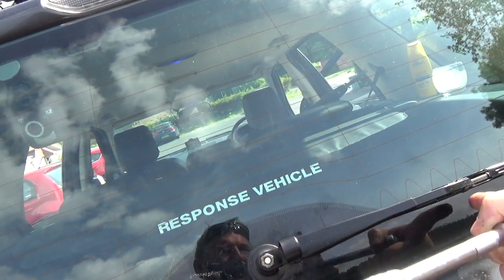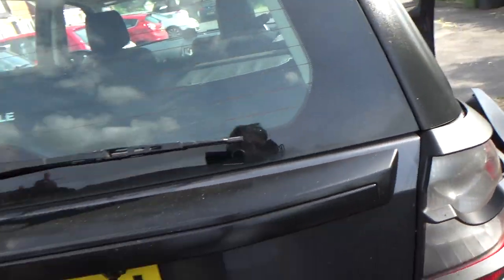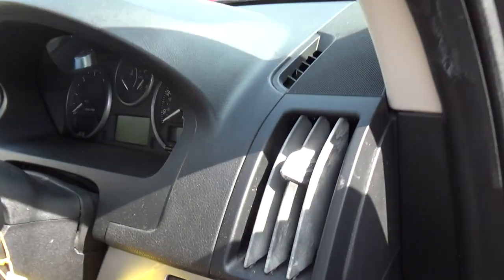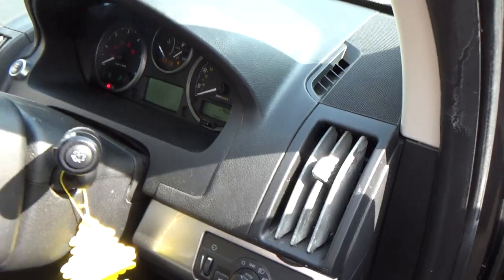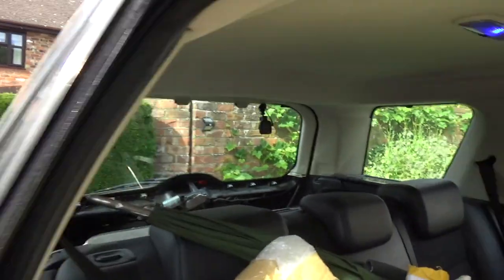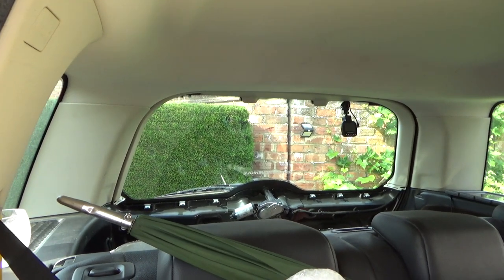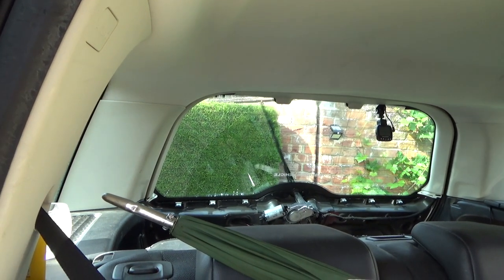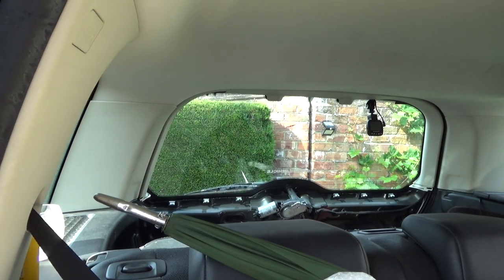Might possibly be a bit low, but let's run it and see. Can always move it one spline. Right, let's run this and actually do a bit of a wash wipe. Right, okay, so let's film out the back. Yeah, that's going too low. It needs to be moved one spline. Okay.